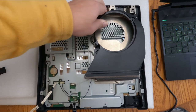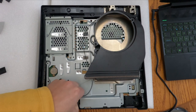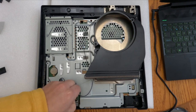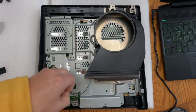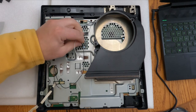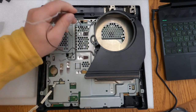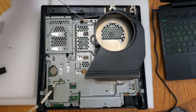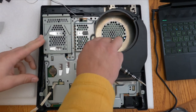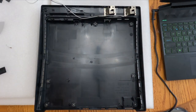And when you do take your main board out of the bottom half of the shell, do the hinge system method. So with the ports on the back, you pull from the front to the back. Right now I'm unrouting the antenna so I can pull out the main board, working away from the front to the back. And out she comes, free and clear.